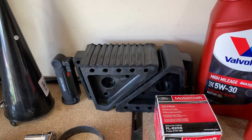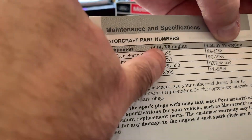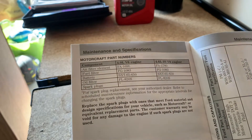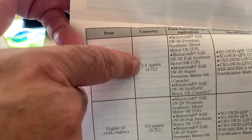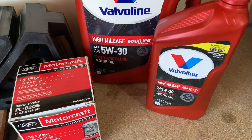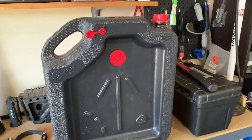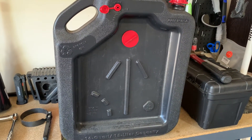If we have chocks, we're gonna chock the back tires so that it doesn't roll off the ramps. Ramps are optional — you can use a jack if you want. Everything you need to know is in your owner's manual. Flipping back to the maintenance and specs, we can see the air filter type, fuel filter, battery type, and the oil filter, which is the FL820s — that's right here, so we got the right oil filter. A couple pages back we see engine oil: for our 4.0 engine the capacity is five quarts. I'm using Valvoline 5W-30 high mileage oil. We also need an oil drain pan — I picked up this one that'll collect the oil; we can easily use this spout to pour it into an old container and take it to our auto parts store for recycling.